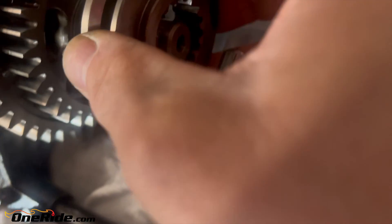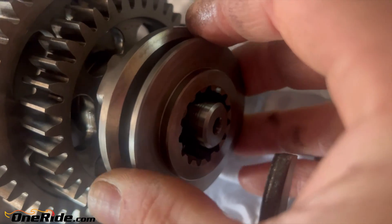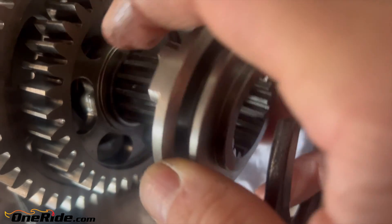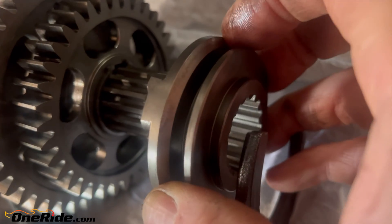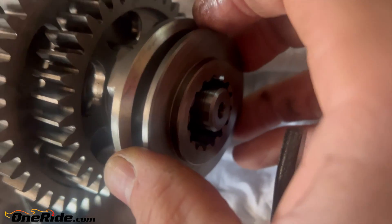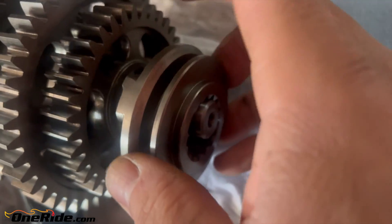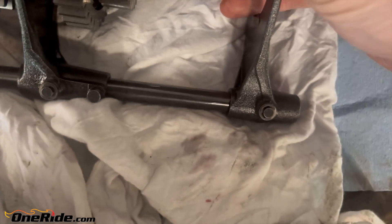When you have the Can-Am rock: if a dog lines up straight with a hole it just goes into place and locks in, and you start driving — you wouldn't have the rock. The problem comes when the dog meets up with a flat spot in the gear and butts against it. Then you have to rock the machine to let it slide into place. Rocking the machine moves the gear back and forth until the dog falls into the hole and engages.